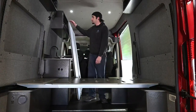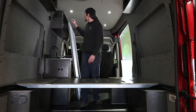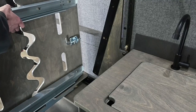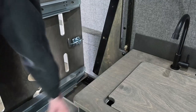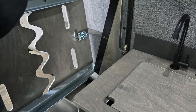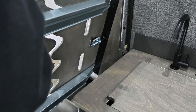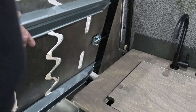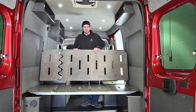The next step is to attach the smaller portion of the bed into this couch adapter. The hooks that grab onto your bed rail are actually going to wrap right around this piece of metal. If you're by yourself, the easiest way is to get this out to where it's going to meet up with the metal right here — that allows you to just pick the bed up, set it into that little groove, do the same thing on the other couch adapter, and then lean the whole thing back and get the top locked in place. While you're holding it, do your hook, raise it up, lock that one in, and then do the same on the opposite side.